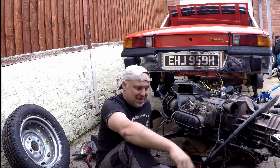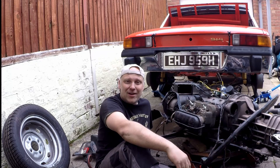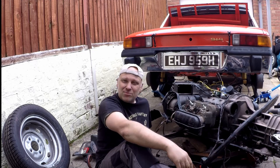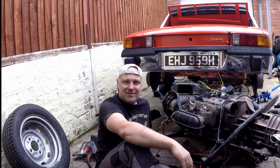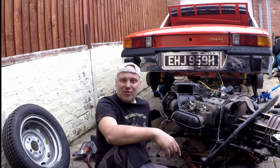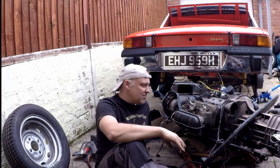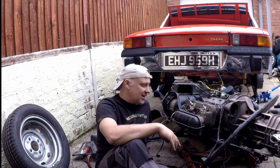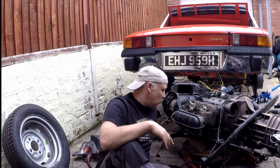That's the engine out. Big thanks to both Ian Carr on his YouTube channel — links in the description below — and also Pelican Parts for having a really good how-to. That's probably made it a little bit easier. I know it's a straightforward engine to get out, but sometimes just doing that little bit of homework makes it a lot easier and you can spot some of those little pitfalls. I'm definitely going to strip down the heads, give it an overall visual inspection. I don't want to take the engine apart — apparently it has had an engine rebuild. It'll be interesting to look in these heads to see what's in the barrel. Just looking at it I can definitely tell it's gas flowed — I do like gas flowed, it's got quite a nice finish to it.